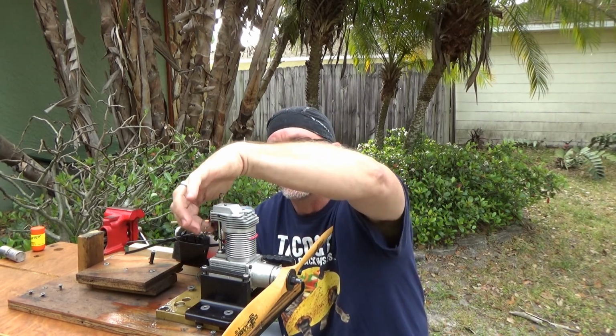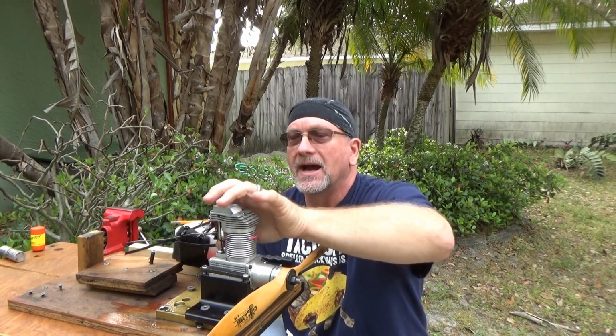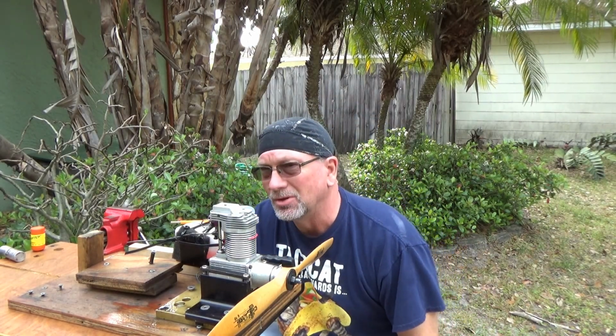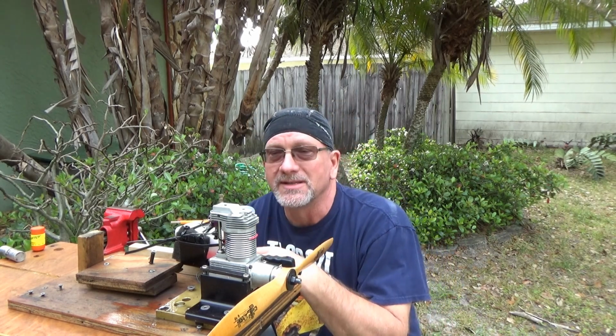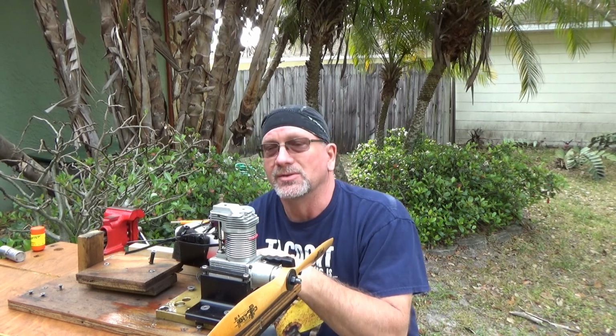not fuel, but there's just a whole bunch of spent oil on the idle needle, which may just be blow-by from these pushrod tubes. The base of the pushrod tubes, I replaced those O-rings. Didn't seem to matter. Still leaks like a sieve there. This engine just has issues.